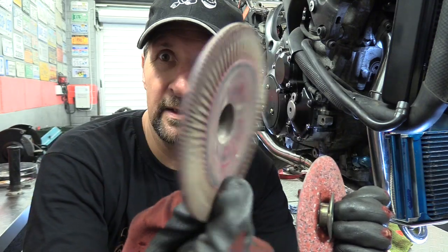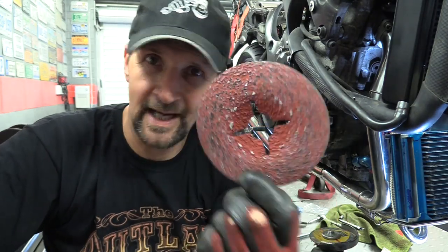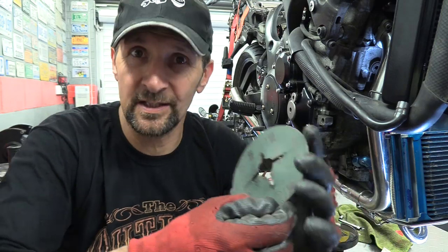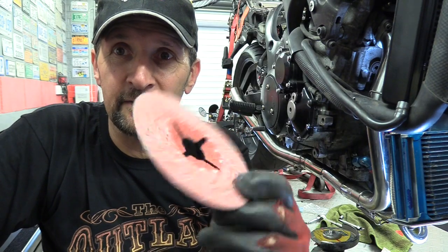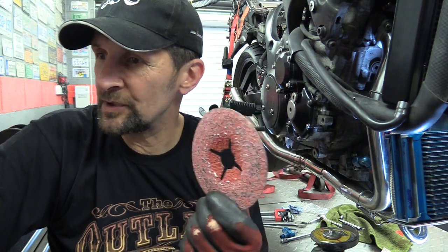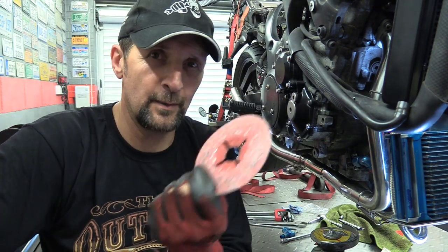has got that back pad. I'm sure you've all seen these. And that's what I was grinding on. It's a sanding disc, a metal sanding disc. This one in particular is 36 grit. I use 36 grit because, as you saw in that video way back, it grinds metal like you wouldn't believe. So I use those because I get a box of 110 of them or something, just like a mad quantity. You get 110 for about 15 quid. And they last, oh, forget when I bought the last ones.